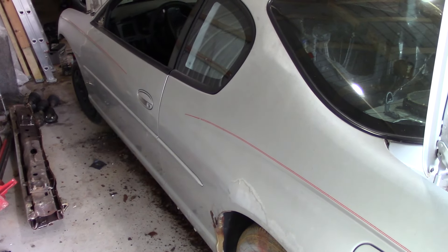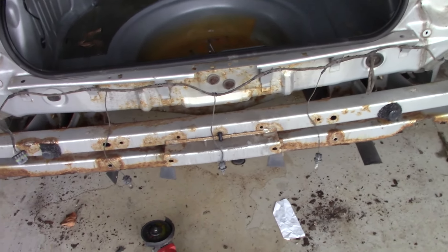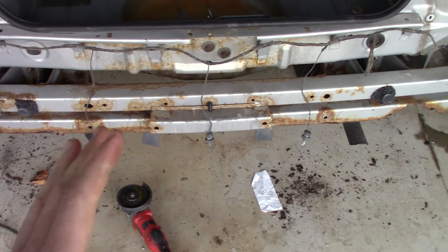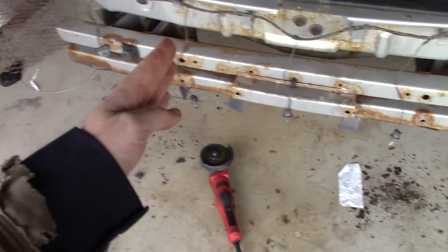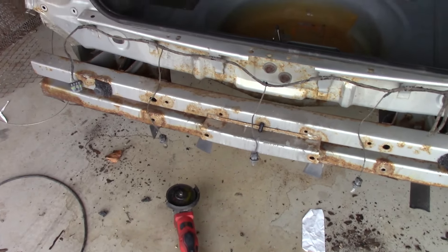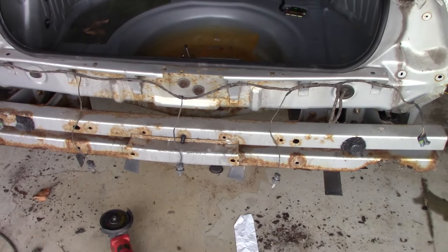Now, why is that? It could be the frame design, but I think it's also because of the interior of the trunk. So what are we going to do to correct that? We're obviously going to modify the rear bumper — not going to leave that on, that's just going to go straight down. I think we'll probably do what we've done on the Luminas in the past: cut the middle of that bumper, toss it out, take your corners, roll that corner up on each side. That keeps uphill pressure on the frame and makes sure we don't just push it down with that bumper rail the way it's designed for collisions.